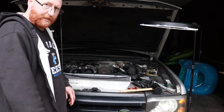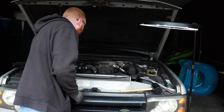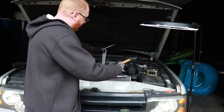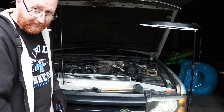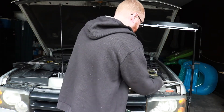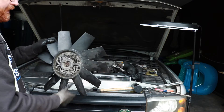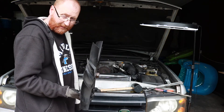I had a little bit of trouble with the fan but I finally got it off. What I did was I wedged a screwdriver down here in between the base and one of these bolts, with the wrench on here like this and you hold it with the other hand. I hit it really hard a couple times until it broke loose — I don't think it's ever been off. Once it broke loose I turned it a couple times. Put your hand in between the radiator as you spin it, that way when it falls off — and it probably will — it'll hit your arm instead of the radiator and won't poke a hole in it.